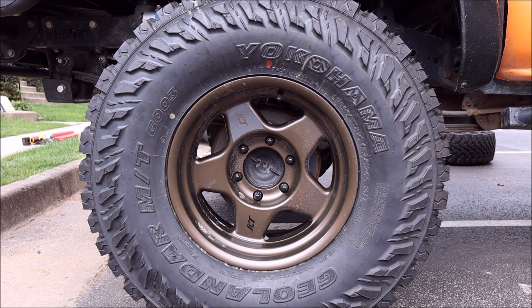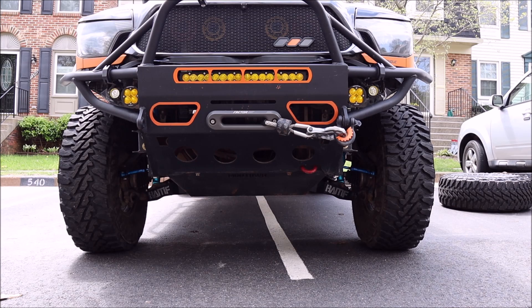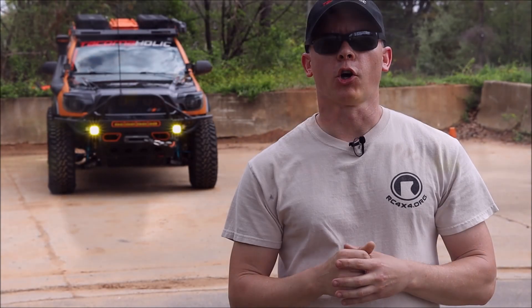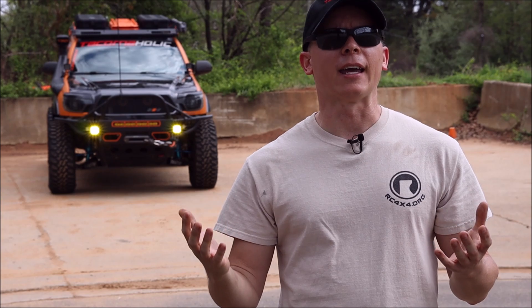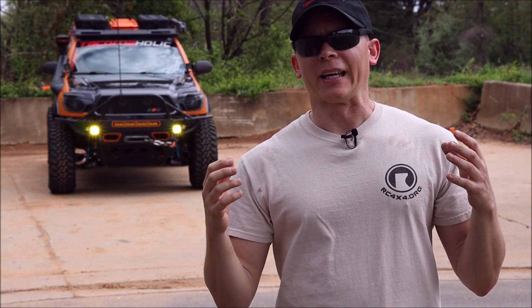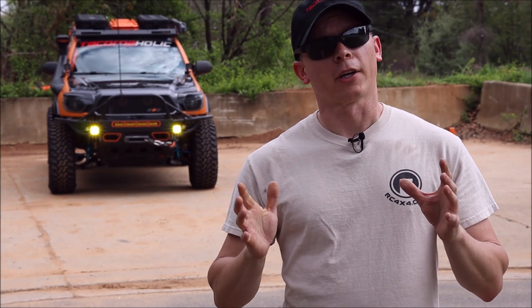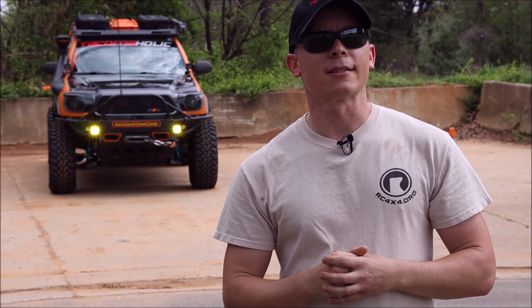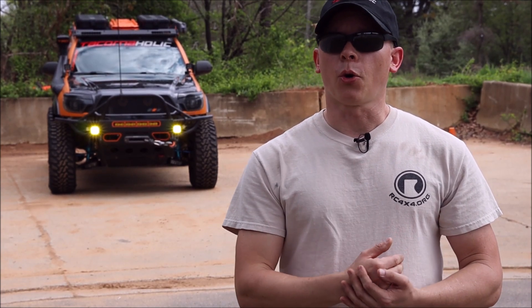With the truck back on the ground and lug nuts hand tight, I went ahead and torqued all the lug nuts in a star pattern to 87 foot-pounds. Got to love that cockeyed stance you always get when you jack your truck in the air. Got the tires torqued down and did a quick test drive — it instantly gets rid of that weird cockeyed thing with the front tires. After taking any tires off, I always like to drive around the neighborhood and put a few miles on the truck in a controlled, close-to-home environment just to make sure I didn't forget anything, and of course got it up to about highway speed to make sure the tires were still balanced. I did have to put about six extra PSI in the spare tire because it's been sitting on my deck for about six months, so don't forget to do that. As always, thank you so much for supporting the channel by watching this video — enjoy the rest of your week and I'll see you in the next video.